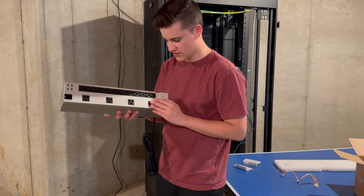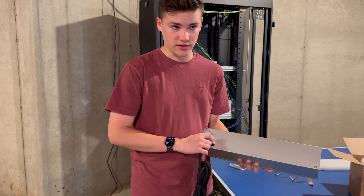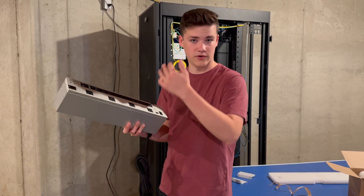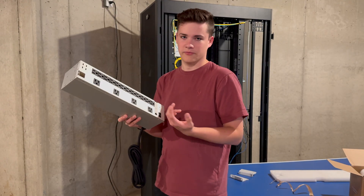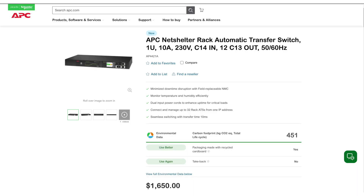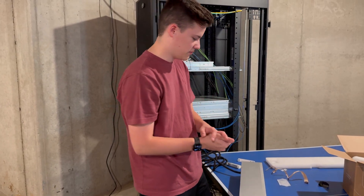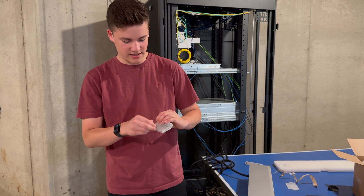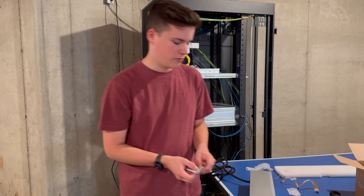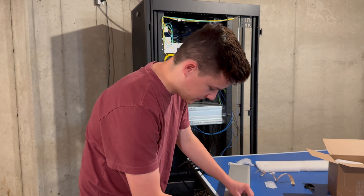This is about $275. As you can see, you've got 16 outlets on the device and four USB-C ports. On the back, we have our management port. It can also be used for your ISP connection — you can have your ISP connection come in here and break it off into two connections to another UniFi router, or if they're in shadow mode, you can fail them over. We also have the Ethernet port here for management on the front. One thing I'd like to see on this device is some kind of failover capability — like the automatic transfer switch devices that allow you to plug into two different PDUs and failover between them. That would be phenomenal. They do have a power backup device, but it's like $400, and having that failover built into a power strip with fast enough transfer to keep everything running would be really cool.